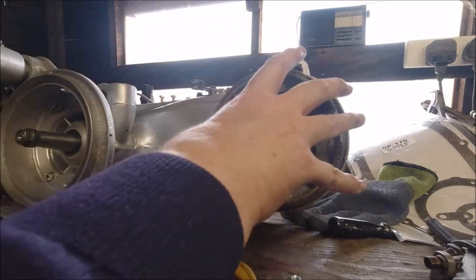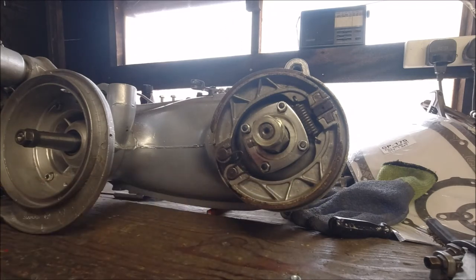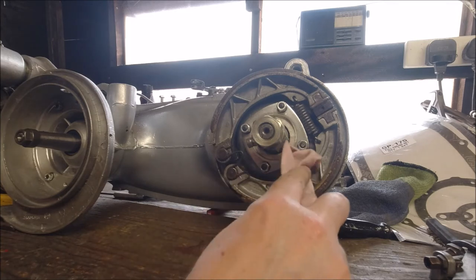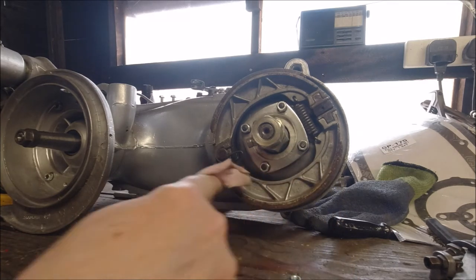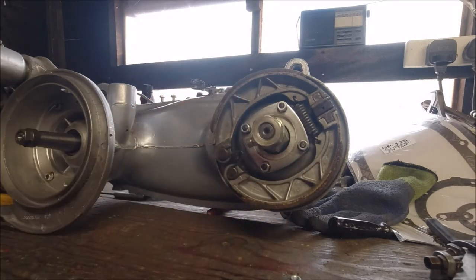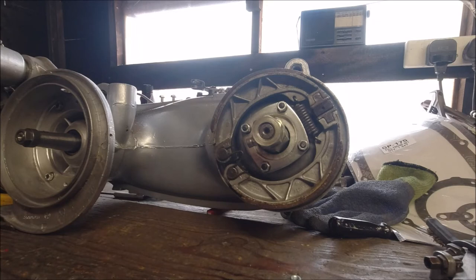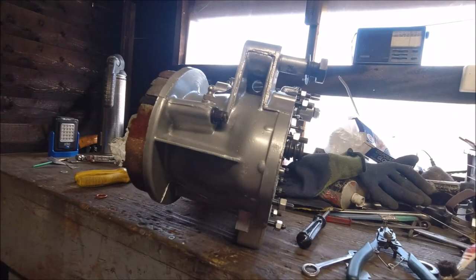That's our brake shoes fitted. If we'd put the Li cam in there, these shoes would be out and the hub actually does fit sometimes — but you're talking millimeters difference between the pair of them. They're not all got numbers on them, but these have got the Innocenti numbers: 2204 GP 19 tends to be normal series three.